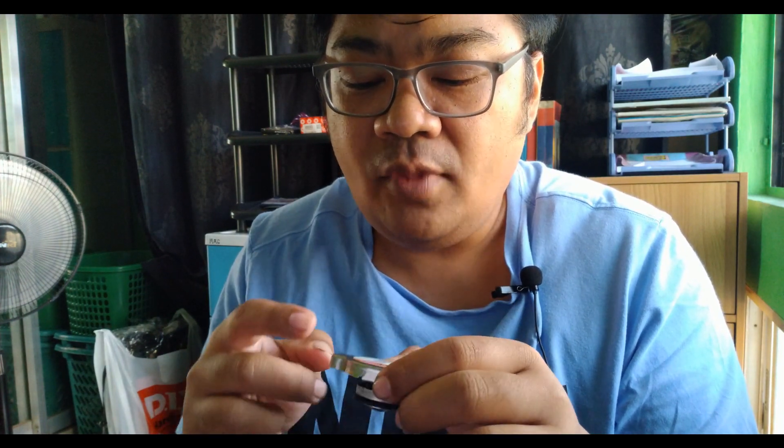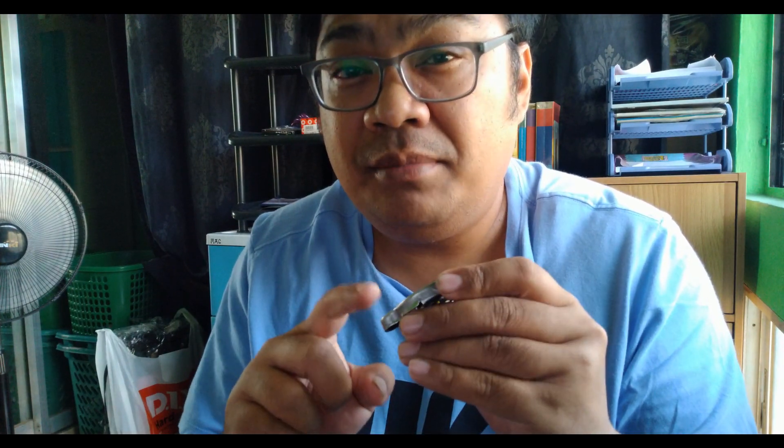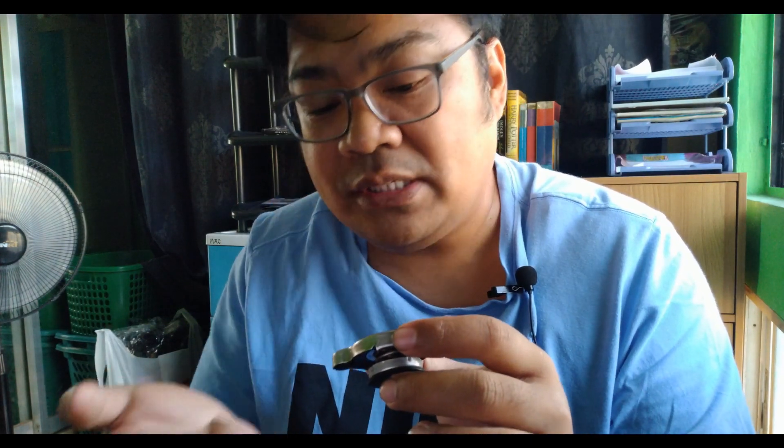When replacing your radiator cap, always replace it with one that is the same pressure rating. It might be slightly lower at 0.9 or slightly higher at 1.2, but that's basically it. Just like I mentioned earlier, increasing the pressure inside your radiator increases the boiling capacity of the fluid inside your cooling system, but decreasing the pressure will also decrease the boiling capacity.